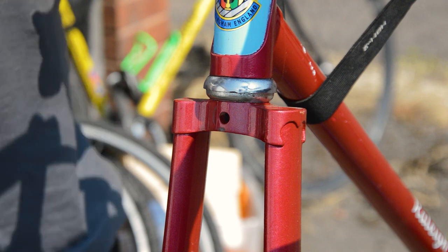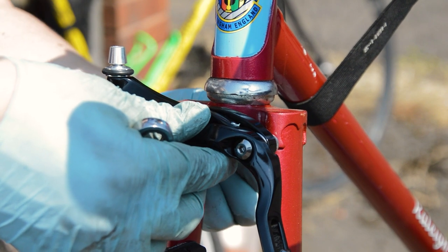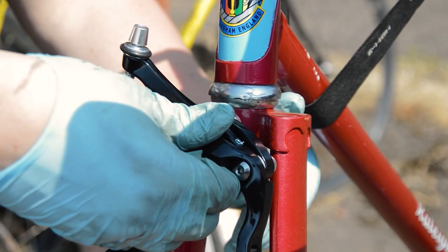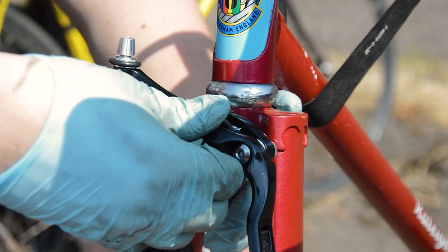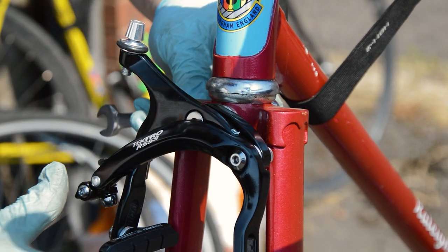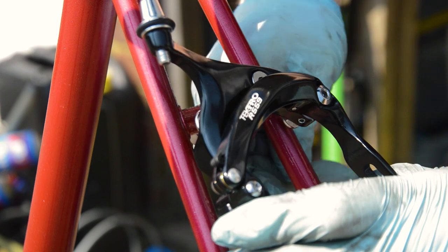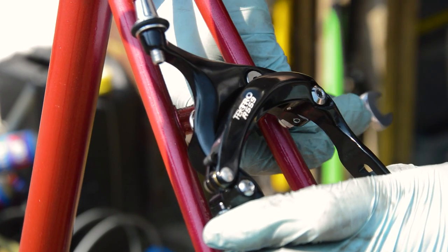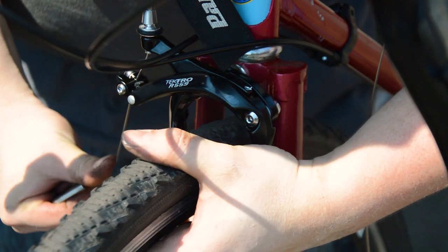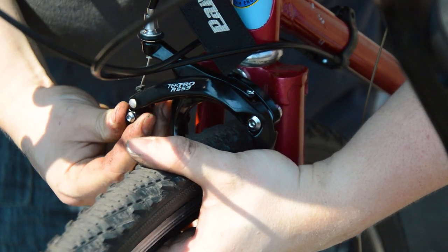Before I forget, the brakes and wheels. I'm sure I mentioned it earlier, but for this build I'm using a 700c wheel set. This bike was designed for use with 27 inch wheel set. Well, what's the difference then, Mark? Good question. The older 27 inch wheels, which already ran long reach brakes, have a bead seat diameter for the tyres of 630mm. Modern 700c wheels run a tyre that measures 622mm. That's only an 8mm difference, or 4mm if you're thinking of brake drop, but it can sometimes throw up problems.